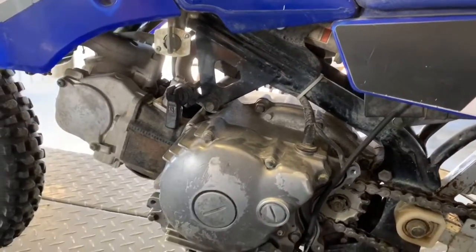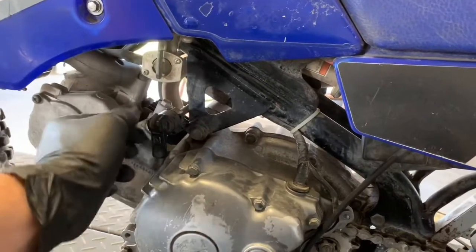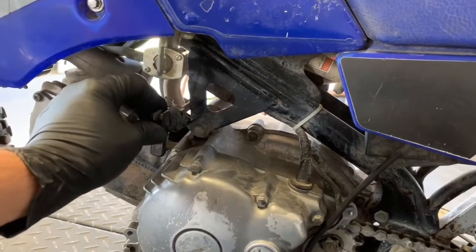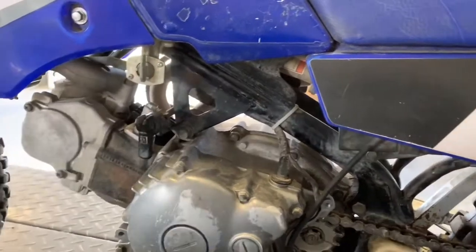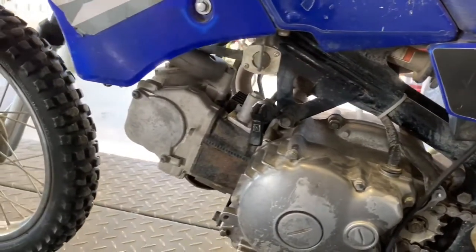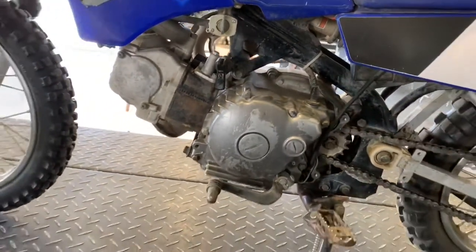We've got your gear shifter on the left-hand side as well. Your choke lever should pull out and stay in one position until your bike is warmed up, then you can flip that knob back down — it should suck that knob back into position. Make sure that you're not riding around for long periods of time with your choke on, or you will foul spark plugs.